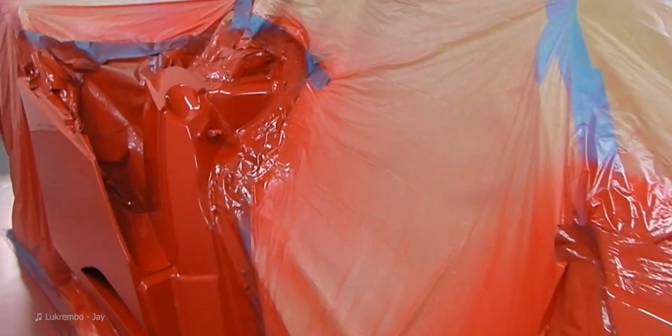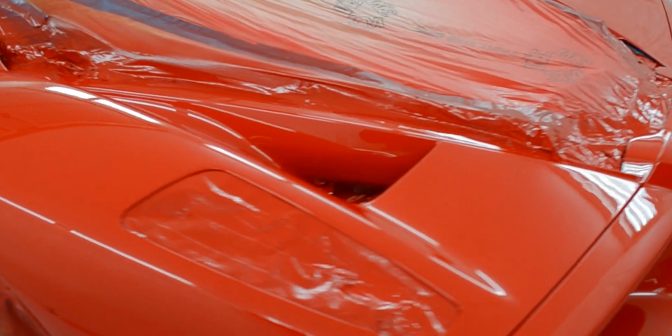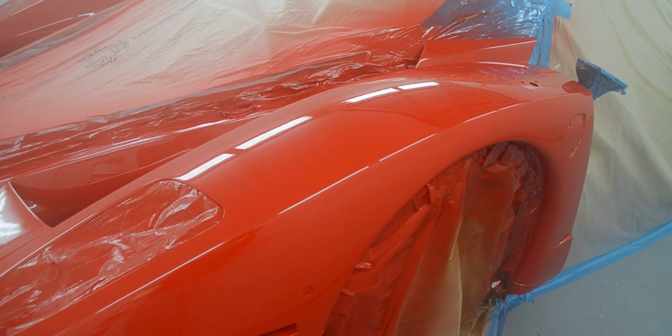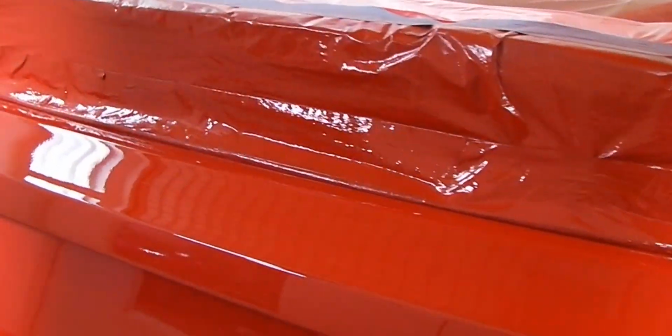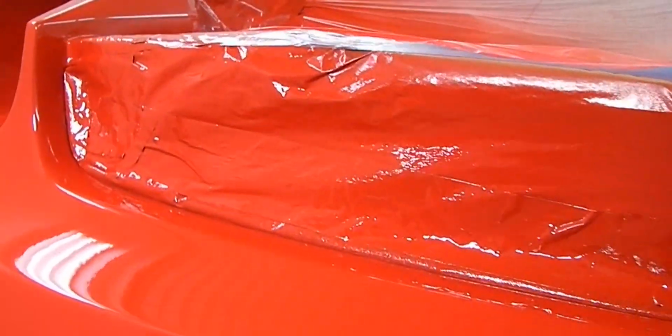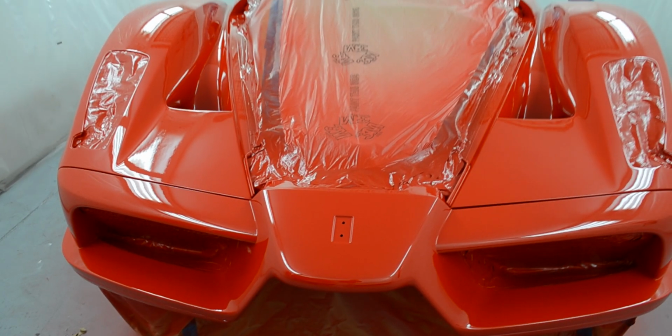So here's what I said about having two visits of clear coat that gives you this stunning finish. It's still going to be orange peely, still going to have a bit of wobbles, but there's so much clear coat on there now, and it's such a wet finish that it gives you plenty to play with when you come to sanding down, blocking it flat, giving the ultimate finish.